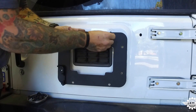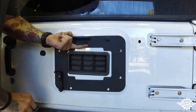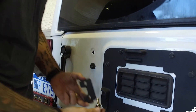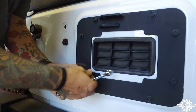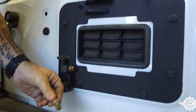Step 10. Using the factory bolts you removed in step 3, install the gate plate onto the tailgate. Make sure the cradle mount is in the bottom left position and leave the bolts just a little bit loose. Step 11. Using the two 3/8 x 1-1/4 bolts and washers, attach the nylon cradle on the cable option. Be sure to install it with the chamfer facing inward toward the weld and just hand-tightened.